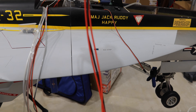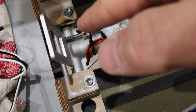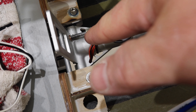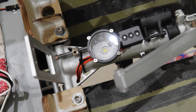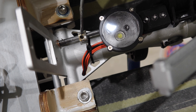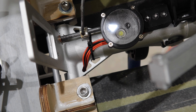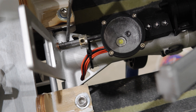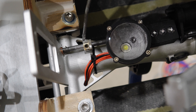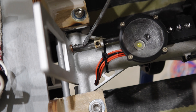We've got a couple of things to run back here. First, the switch for the lighting system needs to get installed. This setup is pretty straightforward — I label these things to keep it simple. The brass one is your negative; since this is a lit switch, the middle silver one is your positive coming in, and the last one is the positive going out to the powered item. That is the switch we're going to use for the lighting system.